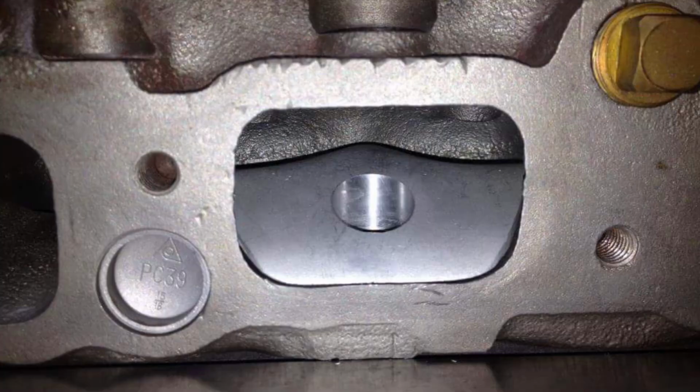I got lump port too. The intake, it's all lump port. It's all polished, ported. 5-angle valve job. I took 35 thousandths off the head. I took almost 100 thousandths off the block to zero deck it. I put in LP pistons. In case you don't know what LP is, it's like on a fork truck, you get a big gas tank. They got a smaller dish. I wish now I'd gone flat tops. Next time I blow it up, I will. And there will be a next time. Of course. So, this one will twist to 5,500 and not hurt the bottom end.